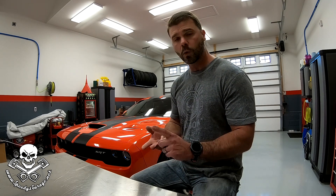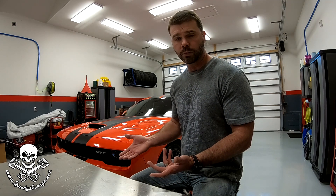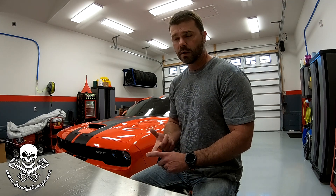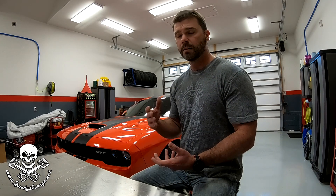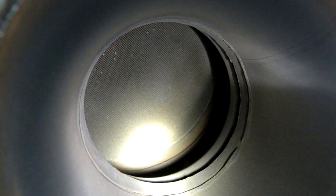I trust what Mike tells me — we're going to be doing that to the car as well. Number three, we talked about fuel. I like the 109 unleaded race gas. He's recommending looking at Q16 leaded race fuel. He says he has not seen any problems with catalytic converters or sensors on any of their shop cars. Our crew chief Greg runs leaded race fuel in his car and has done it for several years with no O2 sensor problems or catalytic converter problems. Mike's shop Jeep makes roughly 1400 horsepower at the crank and it's run on leaded race gas all the time and is still on the factory O2 sensor. Their shop Hellcat has the catalytic converters and everything else on it — Micah posted a picture of the cats after some maintenance and that's what they look like after about three years of running leaded race gas through that car. Not a problem.